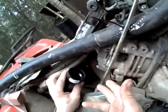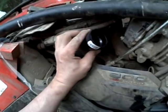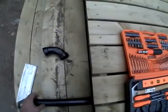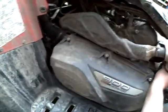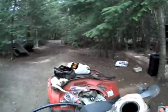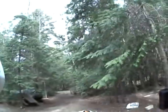I'm going to have to take this out and wrap it with insulation and foil so that the exhaust doesn't burn up the PVC. We want to get everything joined up first, but then we'll wrap the pipe near the exhaust with insulation tape. We'll need to put in one piece of pipe and wrap it all up — it's pretty ugly looking but it'll work.